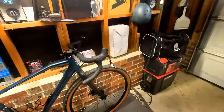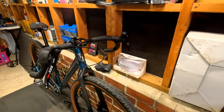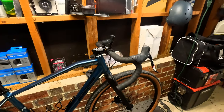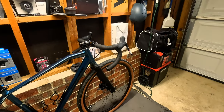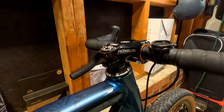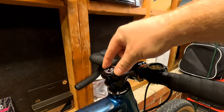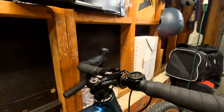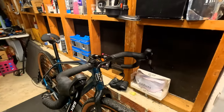Alright, so we're back at the garage. I went ahead and took a look at the steer tube and stem again, and there's no blemishes — that little crash literally did nothing. If that withstood a 183-pound man going down, there's no damage to it. I ended up putting carbon fiber paste in there so that doesn't slip. Then I torqued this back down. It's a plug in there instead of a star nut — I didn't have it torqued down to the right spec. Now I have it torqued to the right spec and that's not going anywhere. My headset should not become loose anymore. It's dreams now, it's good to go.